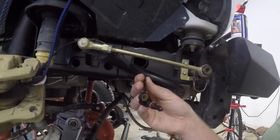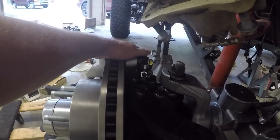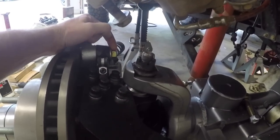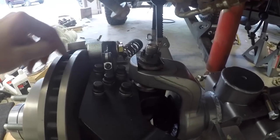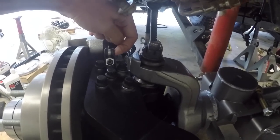One other thing I've run into — I do not have my speed sensor / traction control in yet. To get to it, it's right behind the brake rotor. You've got to take the brake caliper off. I had an air ratchet on max — probably 165 or 200 foot-pounds — and I could not get that bolt off. I'm going to need a big breaker bar. I need to get these calipers off to reach the location where I can bolt the speed sensor in.